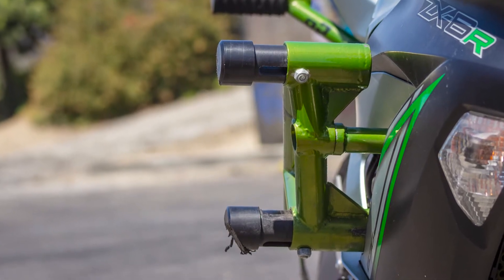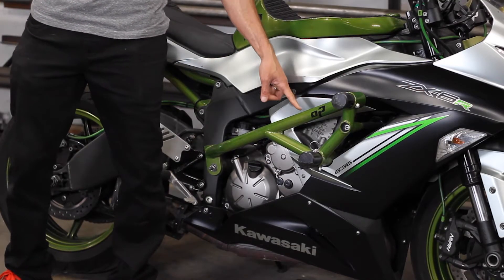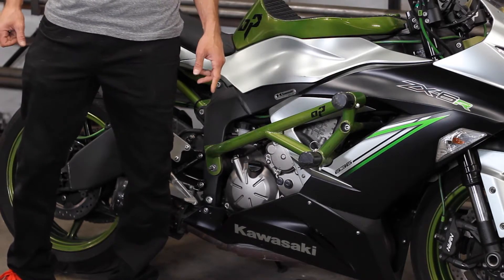When it comes to materials, we want to make sure this cage is as strong as possible to take all the repeated hits we throw at it while still staying lightweight to not take away the performance of the bike. For this we utilize one and three quarter inch DOM, one and a quarter inch steel tubing 120 wall, and three quarter inch DOM on our crossbars.